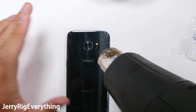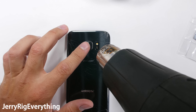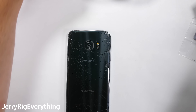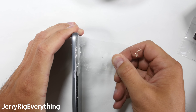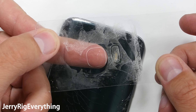I'm also going to use a clear piece of tape. I'm going to take my heat gun — or you can use a hair dryer — and heat up the glass of the camera lens until it's too hot to touch. Then I will quickly put tape over the cracked lens and try to pull off any loose bits of glass that I can find. If you end up with a hole in your lens, this project becomes a lot easier. I got one little piece of glass off, but that will be enough to start.